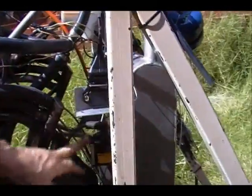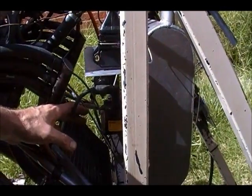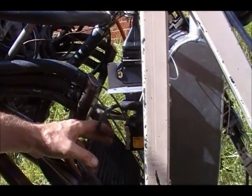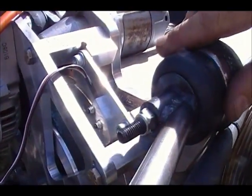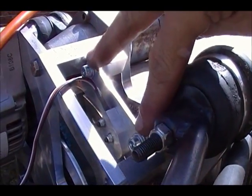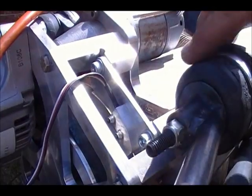We'll be selling these as a kit — the module, the coil, and an ignition lead to plug straight back into the distributor cap. The coil just replaces the original magneto coil and feeds the same distributor cap, so nothing changes in terms of position. The timing is already taken care of by virtue of the fact that these bolts position this plate exactly.